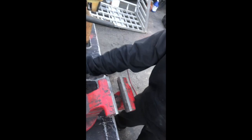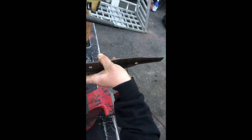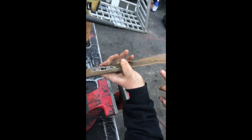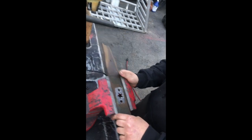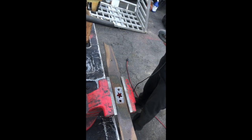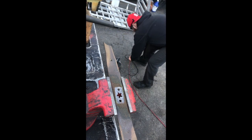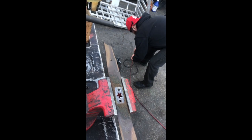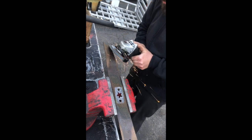All right. So remember, the wing tip up is the side you want to sharpen. Never sharpen here. If anything, just do a quick pass to get the burr out, but never sharpen both sides. A 30-degree angle along the blade, and then one across here, and you're good to go. Power would help. Let's take out this burr first.